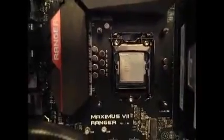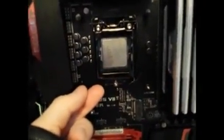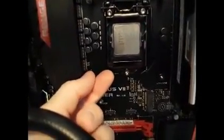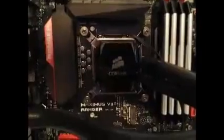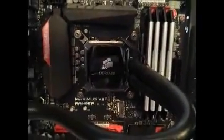I've got the plate back on at the back and I've got the standoff screws in all four corners. It's a bit loose, but when you screw the pump back onto it, it should be a firm and strong connection. It does look too loose, as a lot of people have been saying. We've got four securing bolts back on — do it in a crisscross motion: screw that one, then that one, then that one, then that one, until they're all tight, and then just finish them off with a slight twist with a screwdriver.